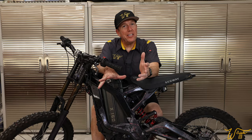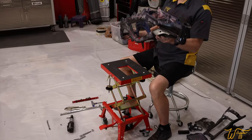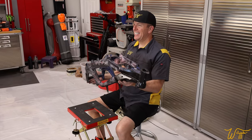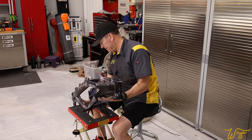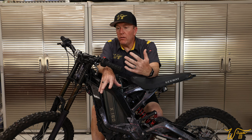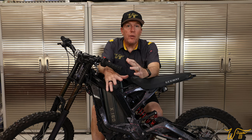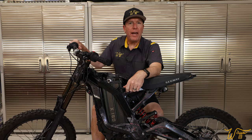So what's the plan for this series? We need to completely tear down this bike. I want to strip all of this disgusting flicker paint off everything possible, get everything sanded, prepped, and repainted. I also want to replace the wiring harness, the throttle, the brake assemblies, and the axle. I need to do a complete service on the front forks — the seller said they weren't functioning, but in reality he just had the compression turned all the way to the point where it wouldn't collapse. So if we just service the seals, we might have more luck than he did.